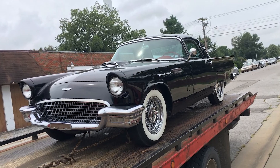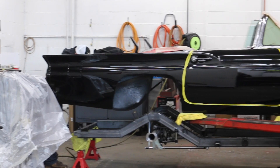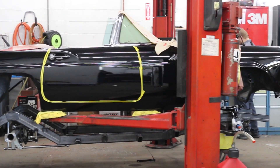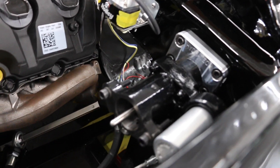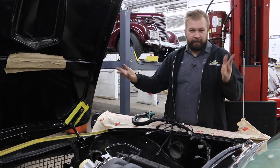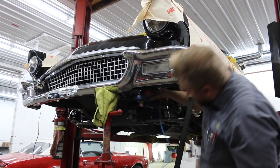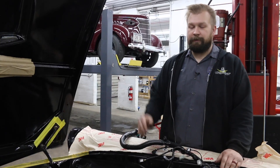This was a restored '57 Thunderbird. We pulled the body off the original chassis — the body is now sitting on an aftermarket tube chassis. It's got a Mustang tube-based front end, a four-link, and a nine-inch in the back. We've done modifications to make sure everything fits: moved the brake booster over, made motor mounts, moved a couple body mounts, and made our bumpers fit. From here we're just making sure our major components have brackets made, holes drilled, that sort of thing.